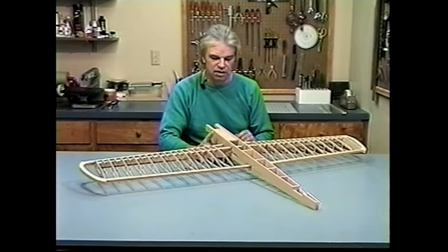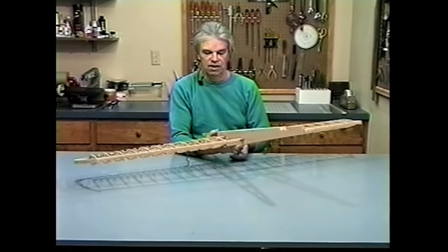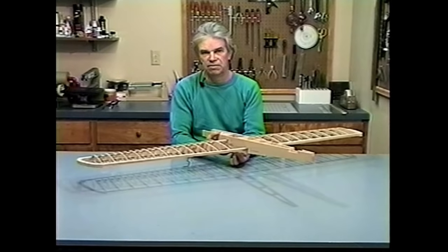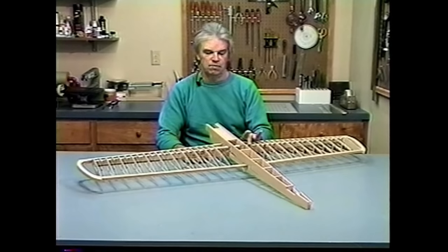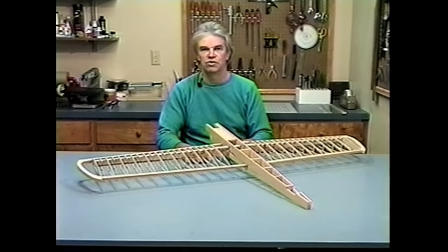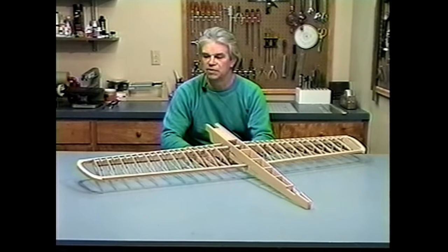Very obvious method. Or you can bolt up halfway through the spar, at which time you would put a flat plate on the bottom half of the cutout. That's a very easy method, and these center sections are so strong that unless you would really dig a lot of holes in there, you almost couldn't hurt it by mounting the bell crank. I'm going to use a 4-inch in here. Plans recommend a 3-inch.